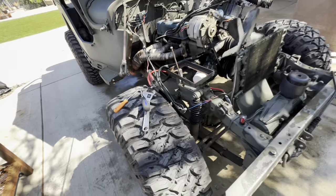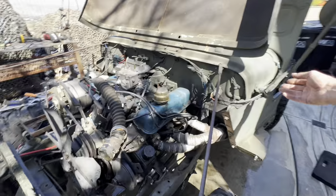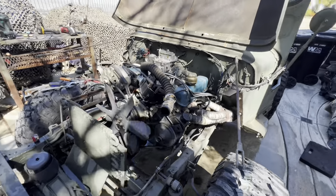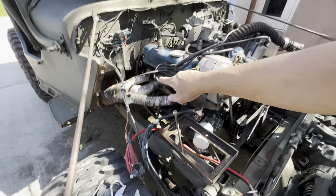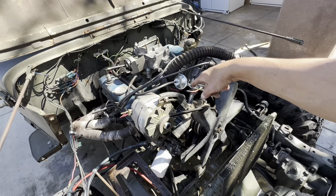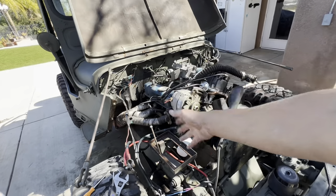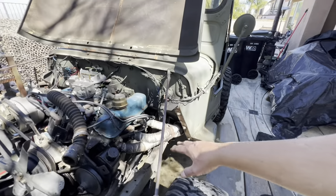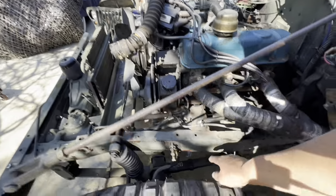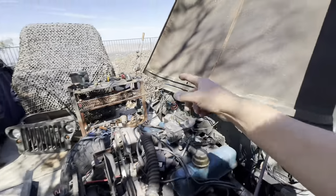All pops off. Disconnect the electrical - go to the headlights and what not. I need to unhook here, unhook the starter wires, unhook my wires from there. Unbolt the header, and then this side will be free. Unhook the header, power steering, fuel line, and take off the carburetor, because we're going to pick it up with the hoist.